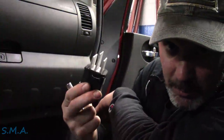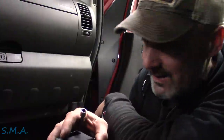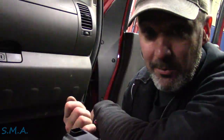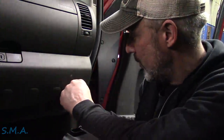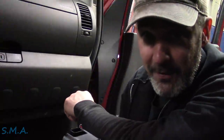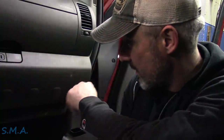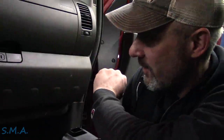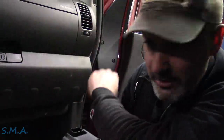All right, folks — well, that's that. Blower resistor, blower motor — in, fixed, done. Cabin air filter replaced so she's got good airflow, and it's got all its speeds now. Everything seems to work well — guys should be happy. I'd be willing to bet that blower motor was making some noise before it all gave up the ghost. So keep an eye — or an ear, rather — on your blower motor. If you hear it making some funky noise, check it out. Could be seized-up bearings like in this case, brushes that are completely shot, or some junk from the cabin air filter that got in there and is getting all jiggly with it. I think I'll jiggle on down to that comment section — the questions, the comments, the concerns. When you're down there, subscribe. Find us on the Insta, find us on Facebook if you're over 60. And just remember: viewers, if I can do it, you can do it. Thanks for watching.